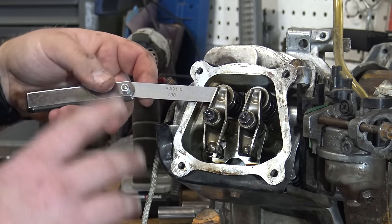This engine is at top dead center because we can move the valve rockers and they're not under any load. Now I'm going to pop off this outer circlip — be real careful when popping this off. I always cup my hand around it so the clip doesn't go flying. There are two grooves in a circlip. You can use circlip pliers, but I find it easier to just pry up on it — put pressure on one of those ears, cup your hand around it, and it pops right out.